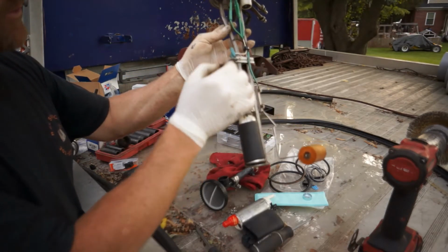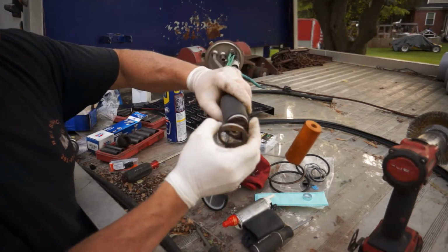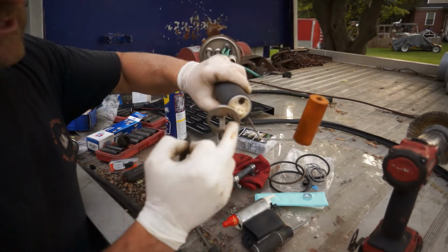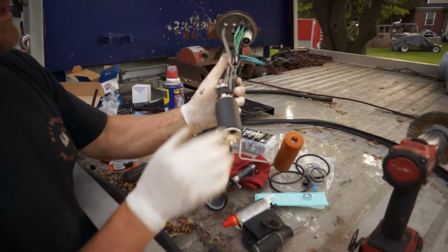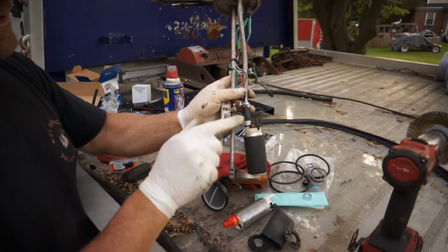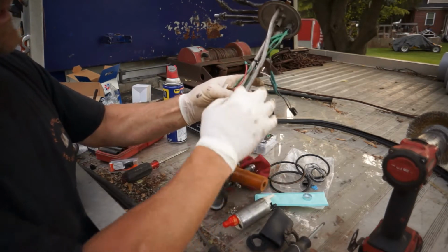And you're just gonna unplug the wire there. Bring this fuel pump up and out of here like so, and it's got a rubber boot on the bottom that cushions it for vibrating down inside this little hole right here on the stainless steel frame. And you just loosen up one of these clamps right here with a Phillips head or whatever kind of clamp you guys have, and I undid this one already.